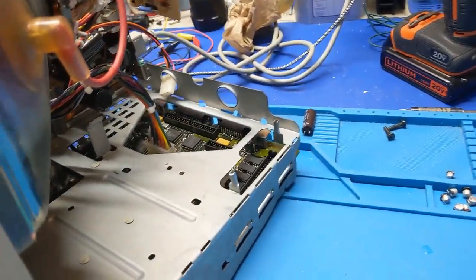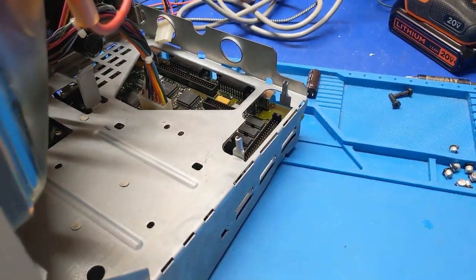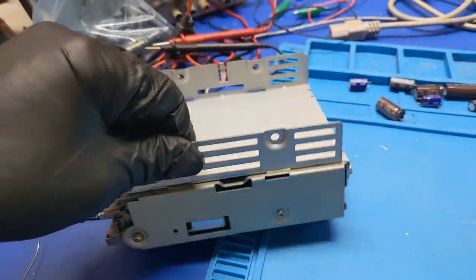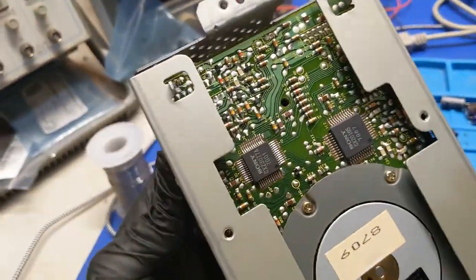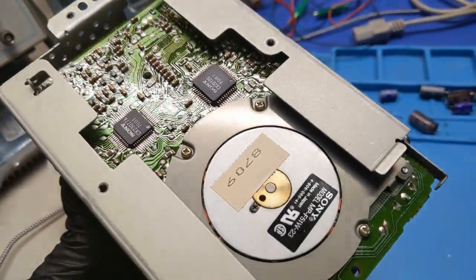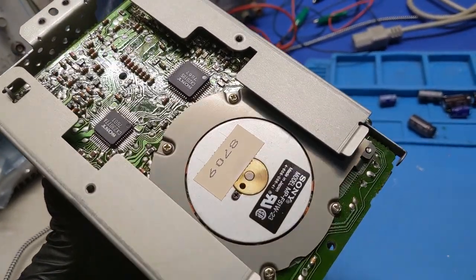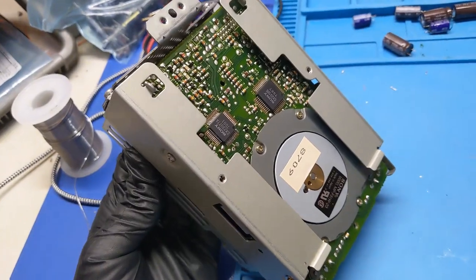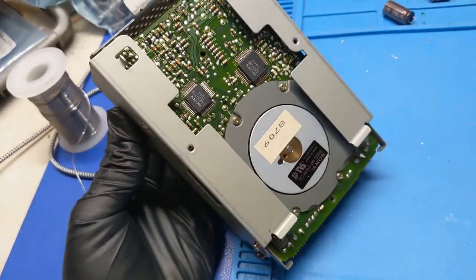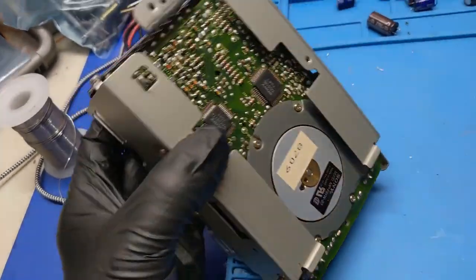It's working! So really, the next thing is to service the floppy drive — new eject gear, lubrication, all that fun stuff. Now that the floppy drive has been serviced, everything should be all good. I've generally not had a problem with these drives — just the eject gear and lubrication. However, this appears to be the wrong drive. Someone shoved an 800K drive in there, so I'm going to have to go digging for a 1.4-meg drive. I should have noticed that earlier — my bad.